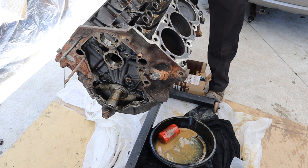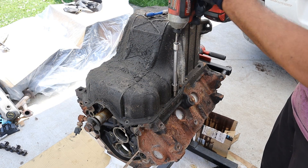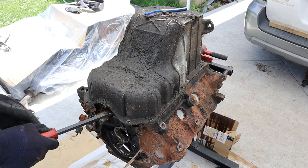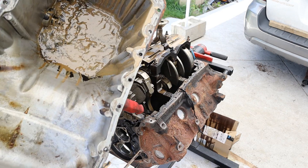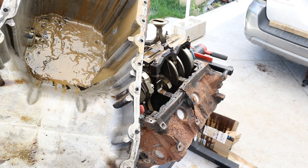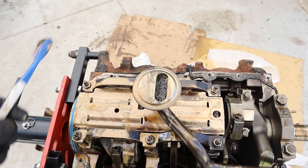The block is now stripped down. I'm going to go ahead and turn this engine over. More coolant. I'm going to go ahead and remove all the 8mm bolts going around the oil pan. I'm actually quite surprised that Ford needs an aluminum oil pan on this thing. Cut that off — it's a really deep oil pan. Oh look at that milkshake inside of there — yeah, coolant definitely mixed with oil. You can see we have aftermarket RTV, so this pan's been resealed. Check out all that junk in the oil pickup tube. I'm surprised this engine actually made it to 300,000 kilometers.